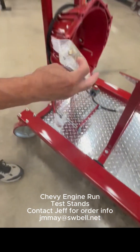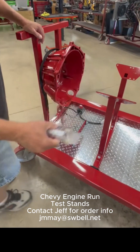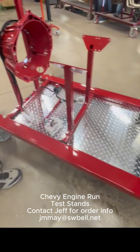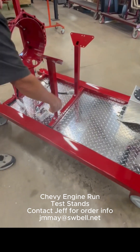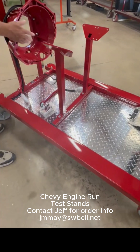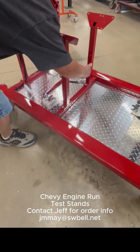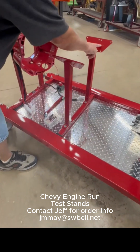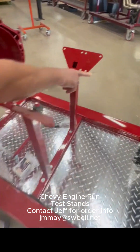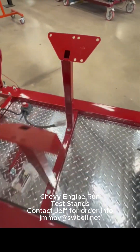This package has got all your fittings for your oil pressure gauge and water temp gauge. The easiest way to load your engine is to remove these two stands — there are two bolts in each one. Just take those off, bolt your engine to the bell housing, and start all your bolts at the bottom and at the top. Be sure that you get these arrows pointed towards the front so that everything lines up properly, and then it'll go right together.